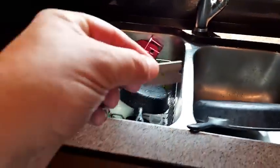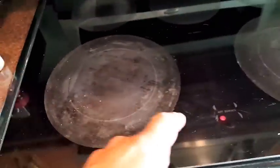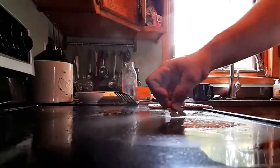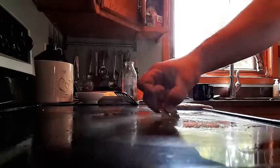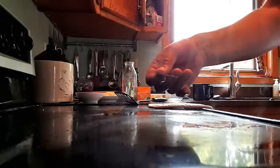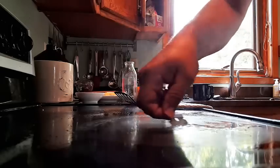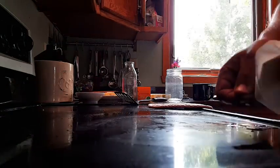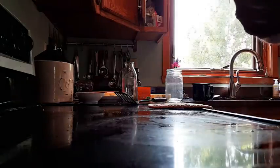You're going to have some residue left on your burner, and you'll always want to keep a razor blade because that's how you clean your stovetop. Right now is not the time to do it because the surface is still indicating it's hot. Once your stovetop has cooled down somewhat, use a cleaner approved by your owner's manual and get in there when it's still fairly warm but not hot. Spray it with that cleaner and scrape off all the material that's making your pan stick. Wipe your blade free and continue working with it. Remember, you're working with a razor blade and a hot surface — a combination for disaster — so be very careful. They probably even sell tools to clean your stovetop, but really all you need is a razor blade. Just keep cleaning it off and you'll get all that sticky substance off the surface of your glass top stove.